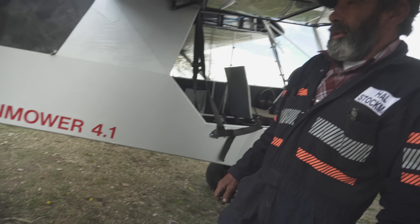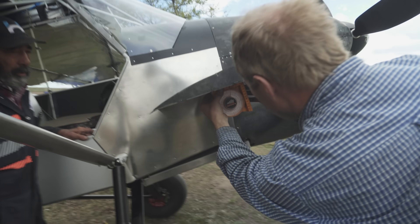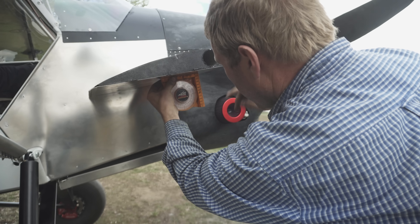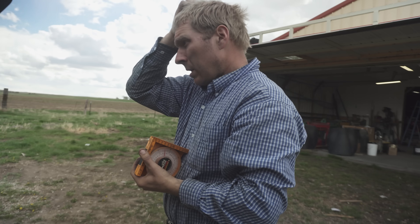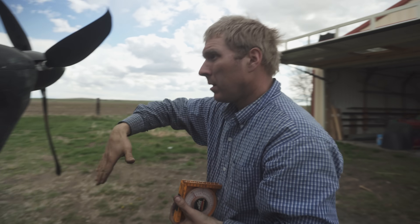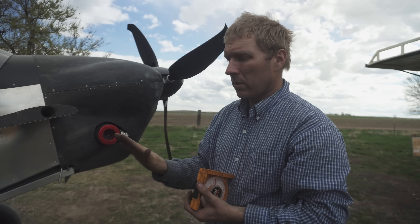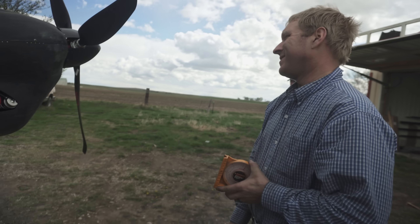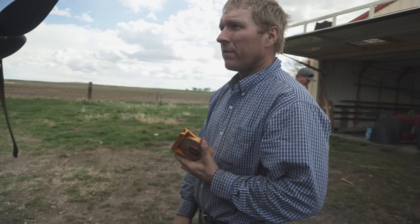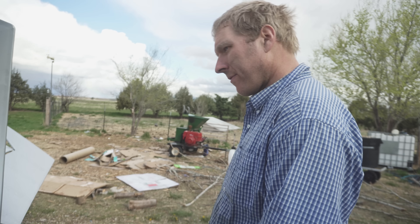Any major concern? Probably not — I can't see anything that would make it so you can't fly the plane. Tail up, right there, about 14 degrees. If anything, my thought would be: if you're in a bind, lower it so it's not lifting — make it a negative angle so you're forcing the tail to push down. It might just be that you have to hold forward pressure because it's trying to lift, but I don't really see that happening. That would be the failure mode. The trim tab tells the tale — he's having to add a little bit of up elevator.